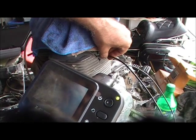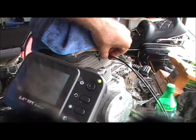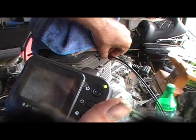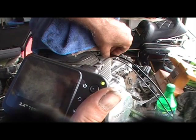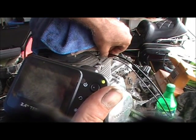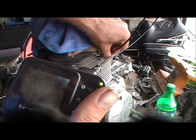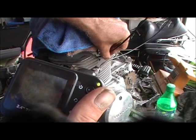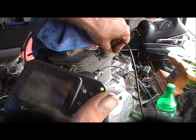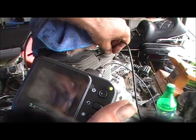I've got a crack in the cylinder wall right there. More melt. And cracks in the cylinder wall all over the place — look at that right there. Another reason to reject this engine.